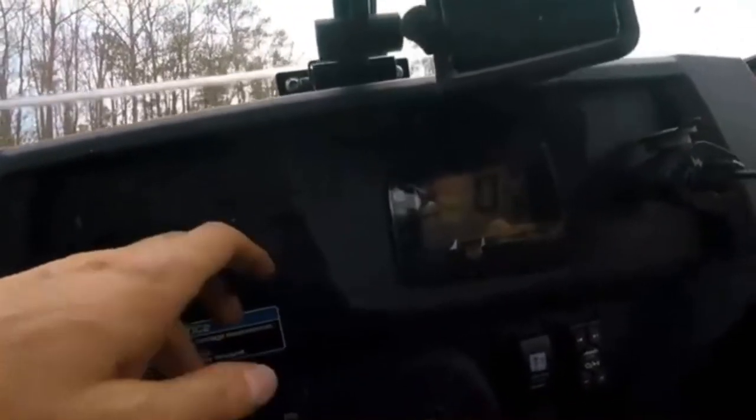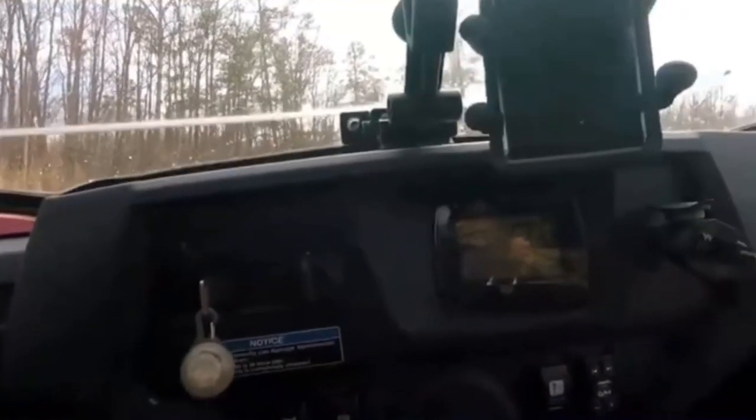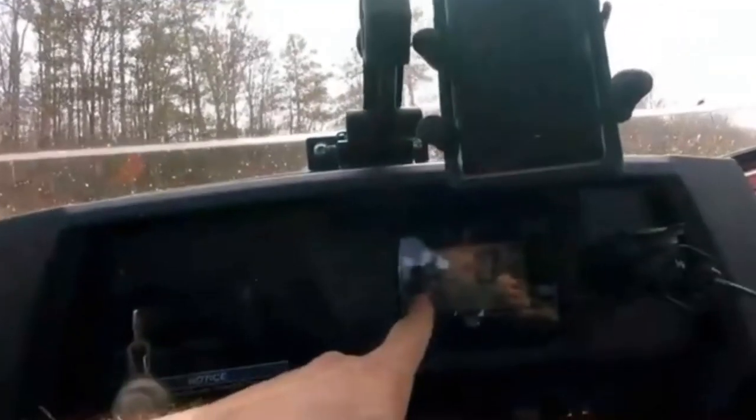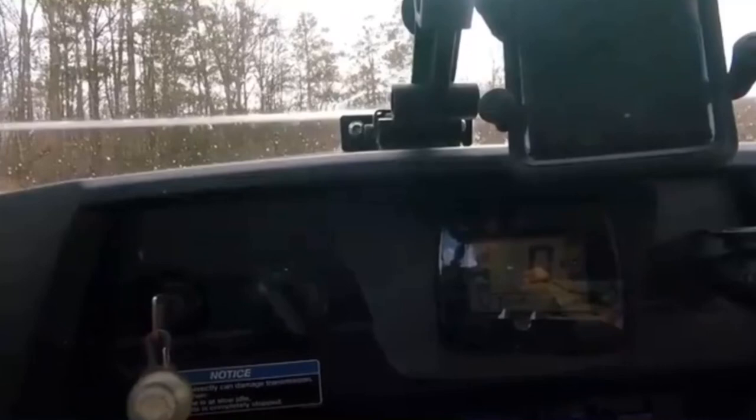Now to take it out of four-wheel drive — it went to two-wheel. If you're in four-wheel drive while you're moving, just turn it to two-wheel drive, then let off the throttle and then back on the throttle, and it'll disengage. When you're in four-wheel drive and it's not engaging, just touch the gas a little bit and let off the throttle — it'll engage every time. And then to disengage, turn it to two-wheel drive and it'll generally go back into two-wheel drive, or bump the throttle and it'll go right out. Thank you.